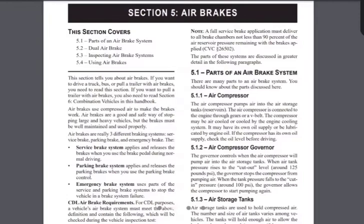Your air tanks have to have anywhere from 120 to 140 PSI. You can't have a specific number because each manufacturer is different — Freightliner is different from Volvo, Volvo is different from Peterbilt, Peterbilt is different from International and so forth. But regardless of who the manufacturer is, it has to shut off anywhere between 120 to 140 PSI. That is the normal operating level for a truck to operate down the road — your air tanks need to be holding 120 to 140 pounds of pressure.